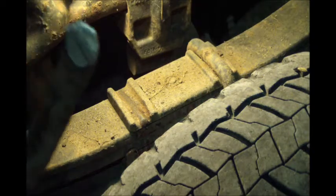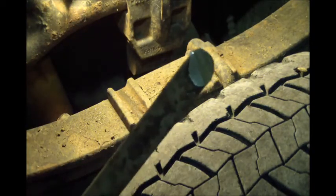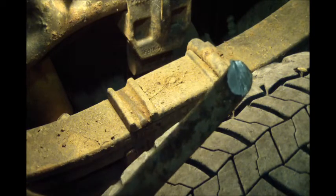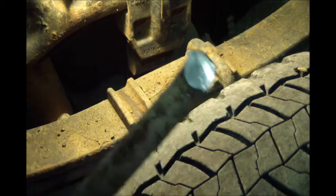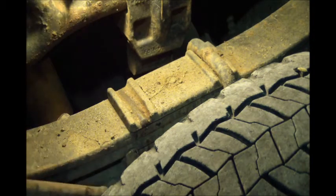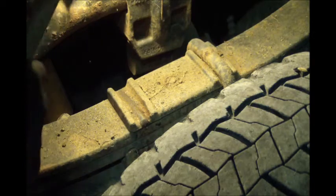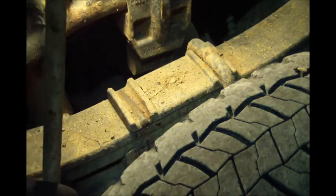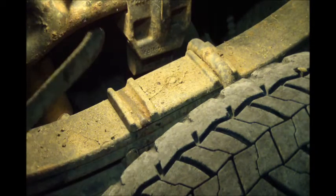You can see it cut about two-thirds of the way through and the rest of it broke - just popped in half. I knew it was going to do that. I made sure to stay clear. The nice thing about doing it this way is the end of the bolt is down in the hanger so it can't fly at you - it can only fly apart. You just have to be prepared and stay back if you're going to do something like this.